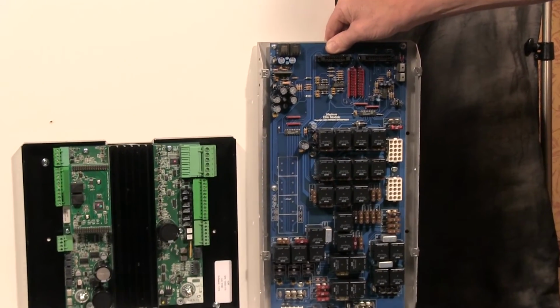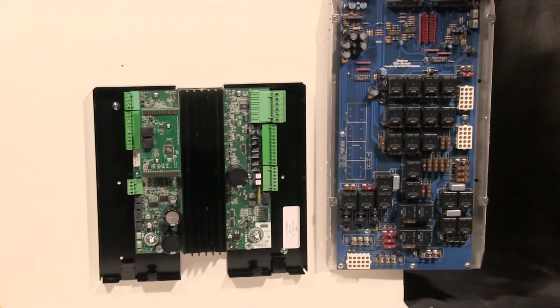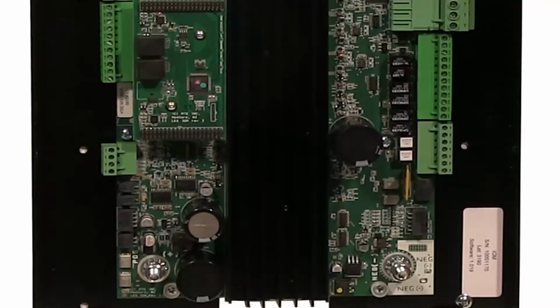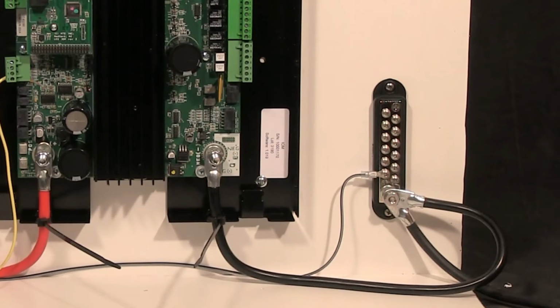Now it's time to mount the Smart Touch IOM. Make sure to mount the IOM closest to the wire connections so you don't have to extend the wires. Before connecting Smart Touch to any components, make sure all the necessary connections are made for Smart Touch to power up. Smart Touch's IOM is a power output module and doesn't have ground connections for the components. If your components are grounded at your old IOM, not at the component's location, we recommend our optional grounding block.